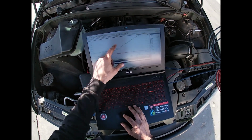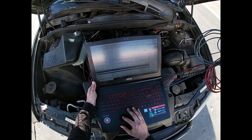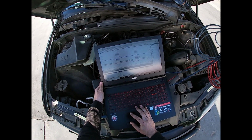I say they're bigger oscillations on this one. That's not a bad spark line, but you can see no oscillations on the turn off when there is there. So, needs a coil.